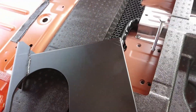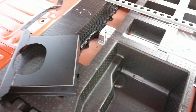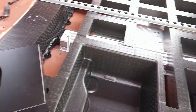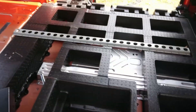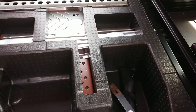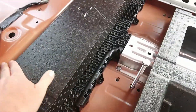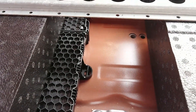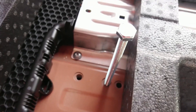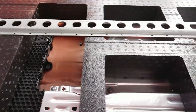The floor's up now and it's quite stuck down in places, it doesn't just lift up. All the trim is pinning it down and then the floor's bonded in places. Now this isn't the same as the video I watched earlier — all that had been removed, showing me that inverted floor down there. What's been a curveball is there's a clear difference in height between the original floor and that section — that's 110mm. To confirm, we can wind an M10 bolt into the captive nuts, which are on the reinforced section of the floor. So we just need to do something now to lift it up and bridge from that mounting point across to the structural mounting point.